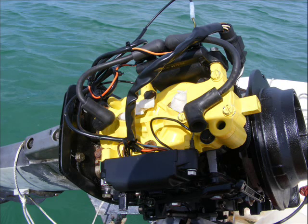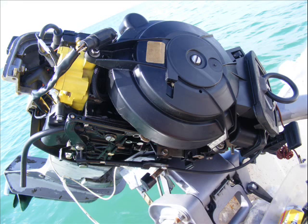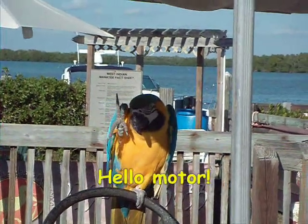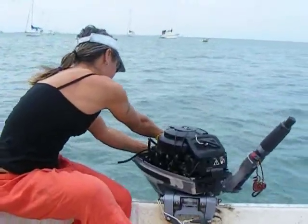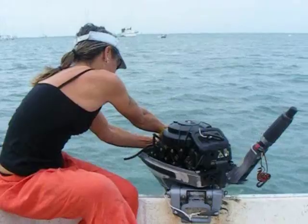There's the capacitor discharged ignition and spark plug wires. Gap and install some new spark plugs, and then test the son of a gun.